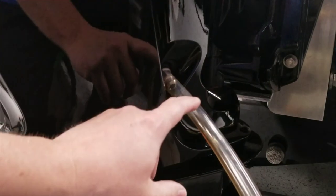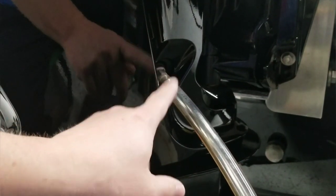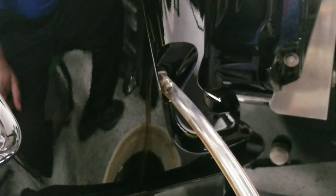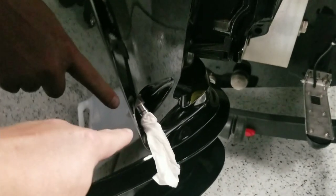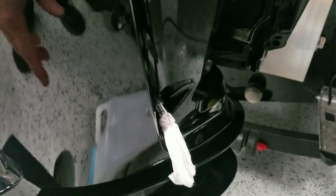We're going to do the reverse here — tighten the fitting, get that all set up. Next we will go up and do the oil filter and refill the engine, 5.2 quarts. Super quick side note: after we pull the tube, I just wad up a little piece of paper towel and shove it into the drain tube. That just soaks up any oil that may be leaking out over time, so I don't end up with a little drip down the side of the outboard.